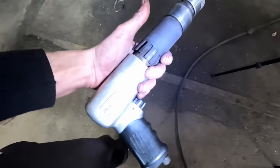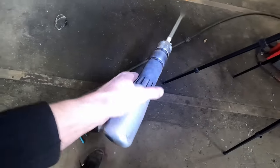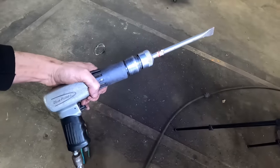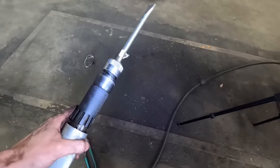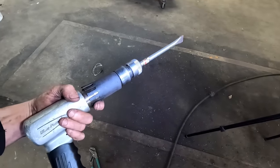My air hammer of choice is a Snap-on or Blue Point long barrel air hammer. A short barrel one might work, but it might not be powerful enough. In reality, you could do this with a hand chisel — it might take a little bit of effort, but you'll still get it off. I hope this video helps you out. I use that trick all the time, not only on exhaust hardware but all nuts and bolts of different types. You don't need to even attempt to get the torch out. If you like this video, please give it a thumbs up, subscribe to my channel, and follow along. Thank you.